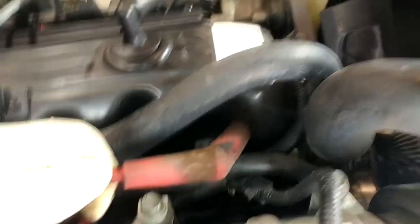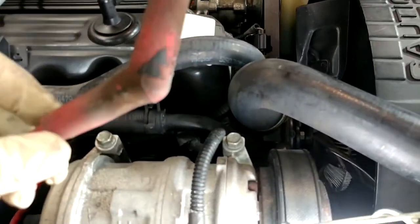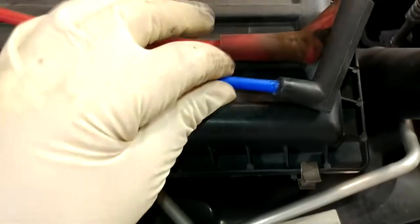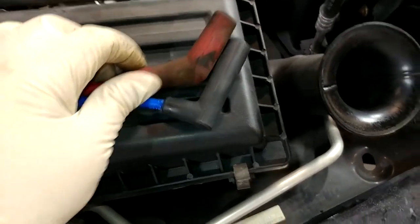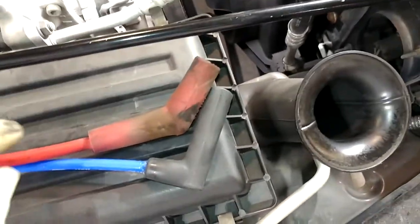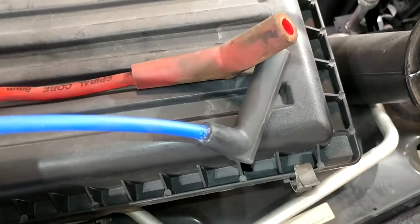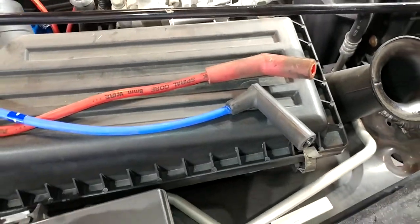Now our wire is out of the way. Let's go compare this to the number one on the NGK set. The boot angle is a little different, and the length is a little shorter, which I think is fine. Couldn't tell you which one of these things is right because they're both aftermarket. One thing I did notice on the NGKs that's interesting is they actually silicone the boots to the wires — I've never seen spark plug wires like that before. And they only do it on the plug end; on the cap end they're just shoved in like normal. Destroying that old one didn't hurt us, so good news.